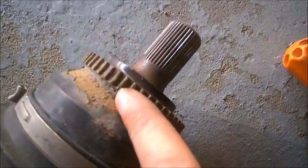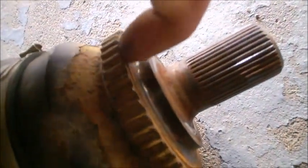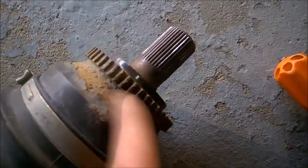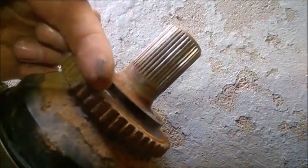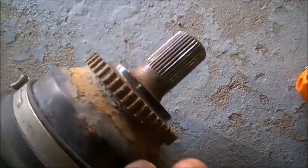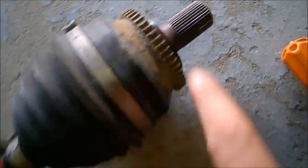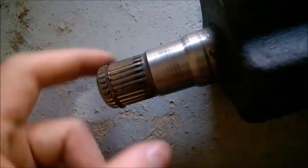I prefer to coat with some grease and rust protector both on the inner edge and on the outer edge. This is the ABS ring — these are problematic because they rust underneath, and the rust will push upward and cause a crack, giving you an anti-skid message on the dash. That's how you protect these things. I also like to put grease on both sides.